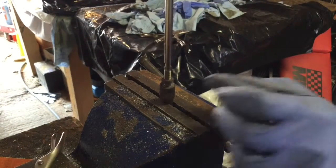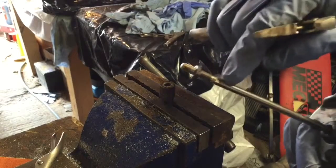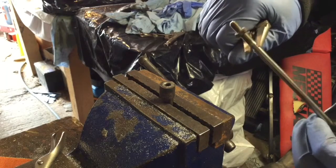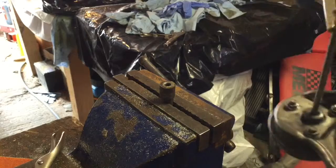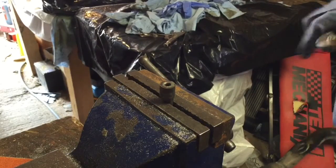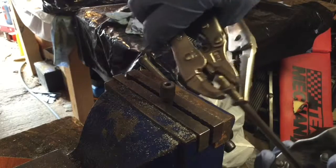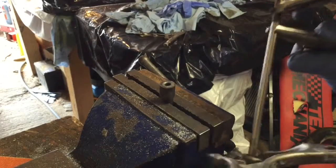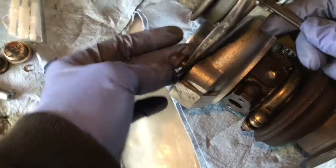So it's just a matter of unscrewing that thing. I will replace the nut that's on it. Then there is a flat here, so you use a long nose vice grip that I clamp on it, because I don't want the rod of the actuator to keep turning. Then clamping this thing once again, it's just a matter of unscrewing the nut without the rod turning on it. So that's all there is to it. So same process, screwing up the actuator in place, bolting it up maybe.